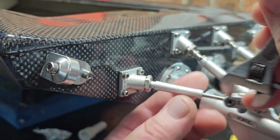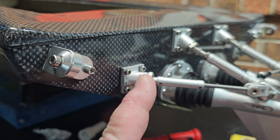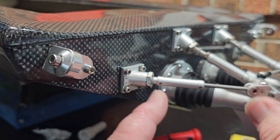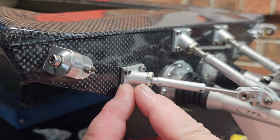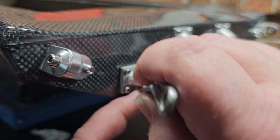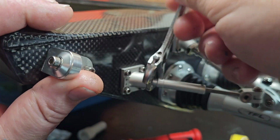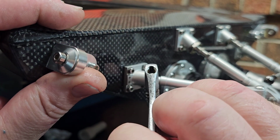If it's not sitting there right, it's going to leak water. Water will get into this base. The way they have it designed, that little O-ring, it's basically watertight. So if you have it put together wrong, that little O-ring's not going to be in the right place, and you're going to get water in your boat. Okay? Well, water in the steering.